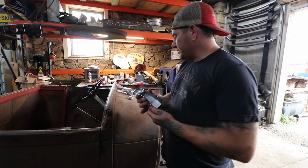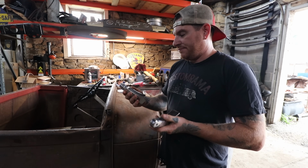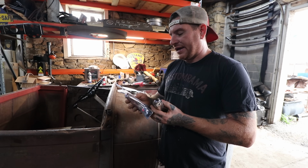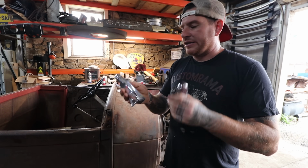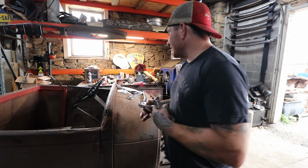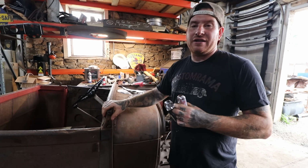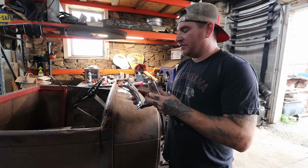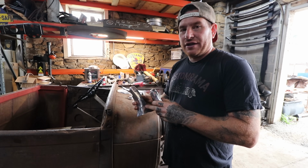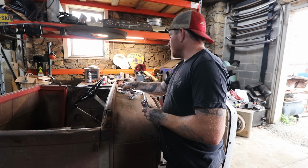Alright, so these cut down stanchions that I got off the HAMB, they are cast aluminum, they're chromed, but they do not come drilled, and I understand that. He includes directions here with a pattern, and I can understand that because a lot of these cars are tweaked and things are not exactly the same on every car. So he leaves them solid like this, and allows you to drill your own holes for the mounting to the car. So we need to do that.